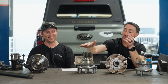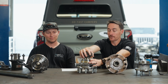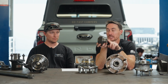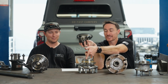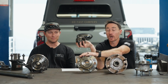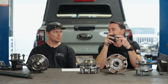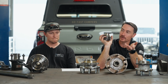Anyways, our gear on our bolt-on stuff presses into the spindle. So if you were to run a locking hub, essentially you would have these two items spin independent of each other. Our gear is case hardened to a specific Rockwell hardness, and I'm not going to tell you what that is. And this flange has a spindle that runs through it that is induction hardened to a different hardness. If you have metal on metal, even with lubrication, it's not the best idea. You could, in theory, put in a DU bearing or an oil-impregnated bronze bearing and then have them spin independent of each other.